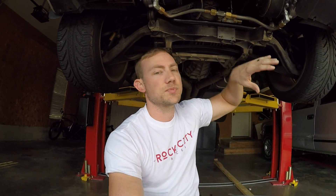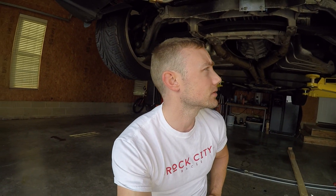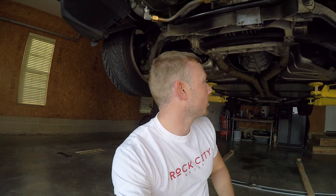Now the one thing I've got to do is clean the oil out of the intercooler because it's been spraying oil up there. Once I clean the intercooler I've got to finish the tune — right now it's about three-quarters finished. It runs 8 psi right now with solid air-to-fuel ratios, but I want to run 10 psi and get the timing finished and the speed density tune done. The engine light's on because the tune's not finished. After that I'm going to rebuild the torque tube — it was silly to tear everything apart with a bad alternator and the oiling problem still present, so I fixed those first.